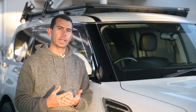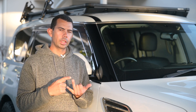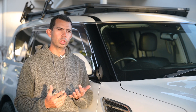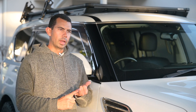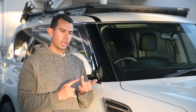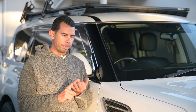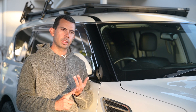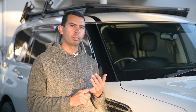I needed at least a three-core for the roof because with white and amber I need two switching wires plus an earth. That's why I ended up with a five-core since I didn't have three. They all connect into the seven-core. I didn't quite need seven cores yet with only lights on two sides - I've got a main earth, white and amber for the left side, white and amber for the right side. I've allowed for lights on the back which would take up all seven wires, though I'm not sure if I'll put them there yet.